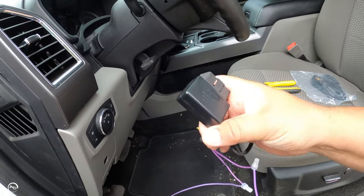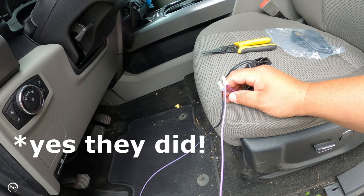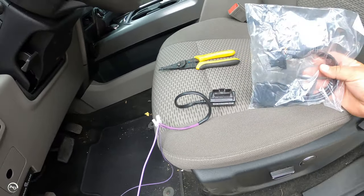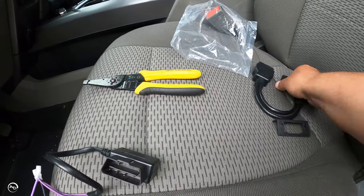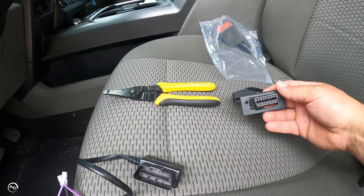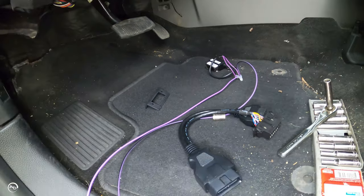This is the OBD2 plug. You just match up the wires — one's purple, one's purple with a black trace. They didn't give me any connectors for this, but I keep these. This was not in the kit — I purchased this separately — it's an OBD2 splitter. It comes with a new mount for the front. This plugs into your existing port and splits it, so the new mount goes onto one side like so, and you'll mount it under the dash. I'm going to unbolt the OBD2 here, take that port out, plug in the splitter, and remount.